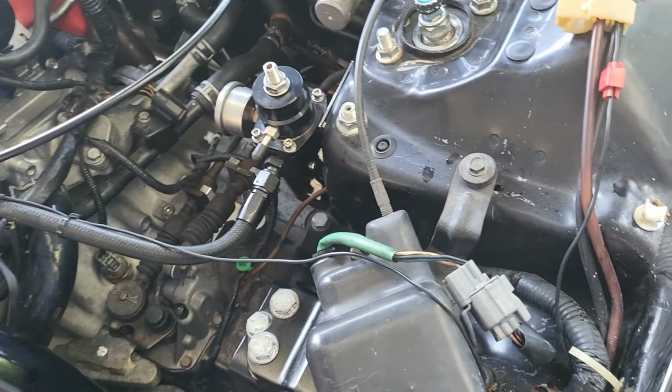You got the black, which is coming from the reservoir on the top, and then you got the wire right there, which is that green and red, or in the camera how it kind of looks orange. But there you go, you splice it onto that side of the connector, which is, I believe, the male side, because that's the prongs. And then obviously on the other side you got the conversion harness going right into it, which is pin 18, which is missing on that pin if you notice. But like I was saying, hybridracing, from the only one that I've seen conversion harness wise, has it, so it will defeat the purpose of you doing all this annoying thing right here, which is super hard.